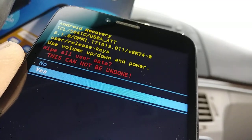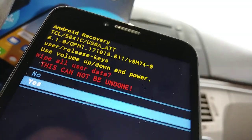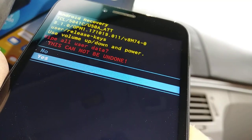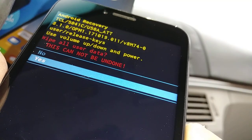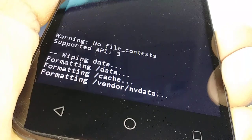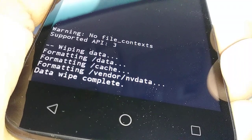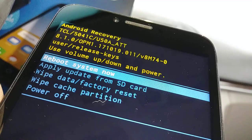You need a backup before doing the factory reset with the external buttons on the phone. When you're ready and agree with everything, just press the power key to continue. At the bottom you'll see wiping data, formatting data, vendor complete, and then wipe complete.